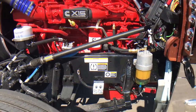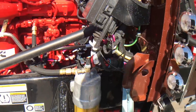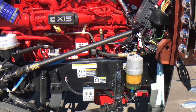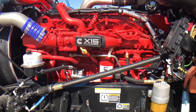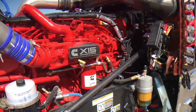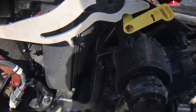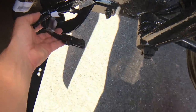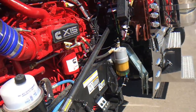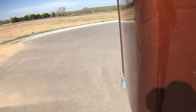There's the new Cummins X15. It's got a heated fuel filter water separator and an arctic wrap on all the fuel lines. I've got extra insulation in the cab and the sleeper — winter is right around the corner and that option will pay big dividends. It's pre-wired for fog lights or road lights; it's already wired with a switch to the dash. Like the Phoenix light kit, it's just plug and play.